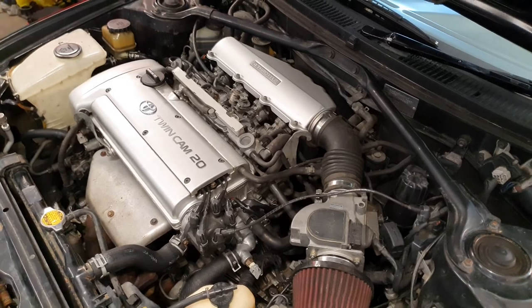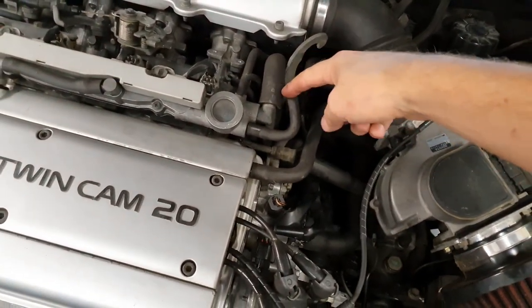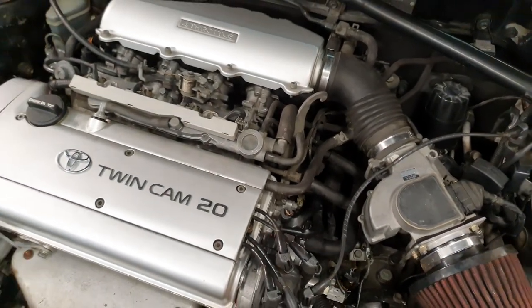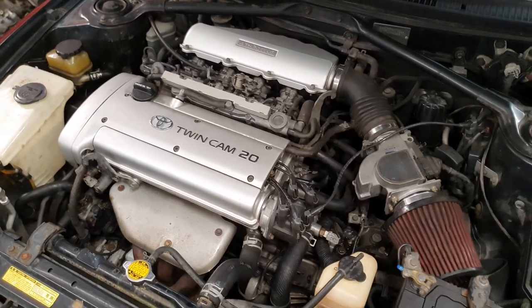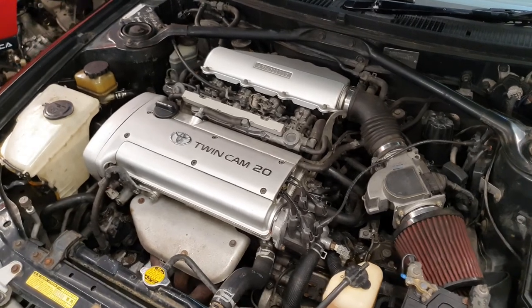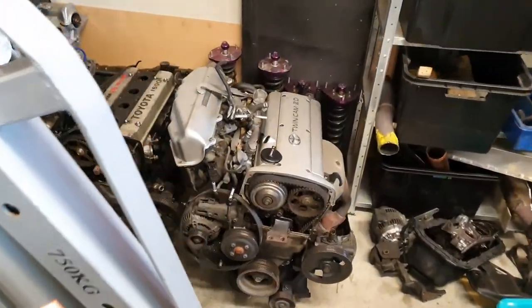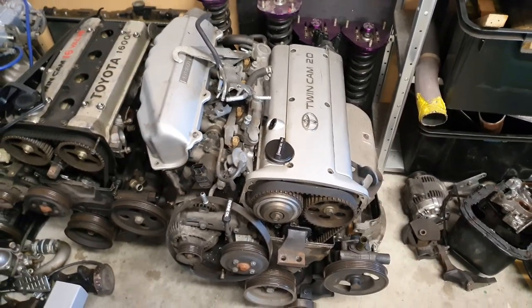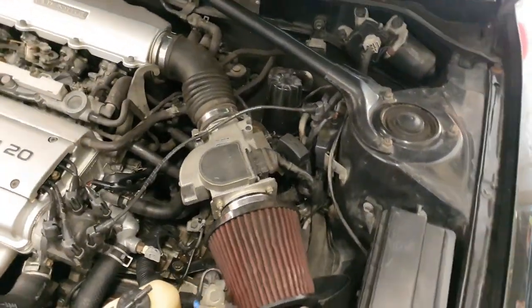I've been reading on some YouTube clips - some people put basically a bung in there just to stop the airflow going through. It starts a little bit rougher, but as long as you're around the car to keep the revs up while it's dead cold, it helps when the engine's hot. I could replace the other valve on here but I can't be bothered unbolting everything to get down to it, especially when I'm not going to keep this car for ages and ages.